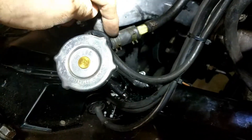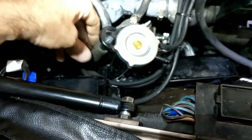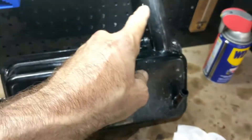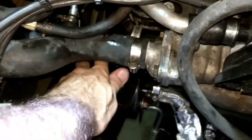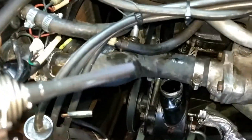I'm going to remove this as well, just at this point, which plugs into this thing. I've bound all this up — it's all related to the evaporative system. That goes back to the water pump, and that comes from this system here. That part goes to the expansion tank, and there's the water sensor. Now there's the pump — it's a little bit hidden because I put too short a belt on it, I think.